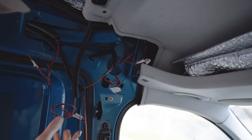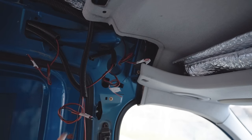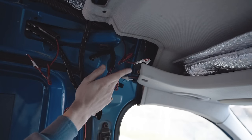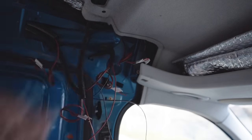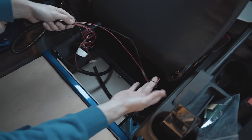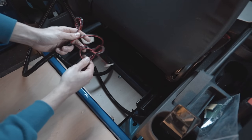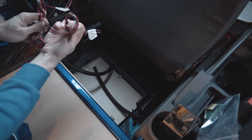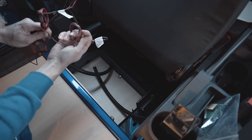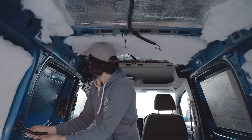As you can see, we've got quite a few cables running through here. Now I'm just running a red and black to most of all these. We're going to have four switches up here. So I like to tie every cable at the ends just to make sure it doesn't accidentally get pulled through later. And then I put a little label on it just to remind me later down the line when we go to hook all these up as to which destination it's going to.